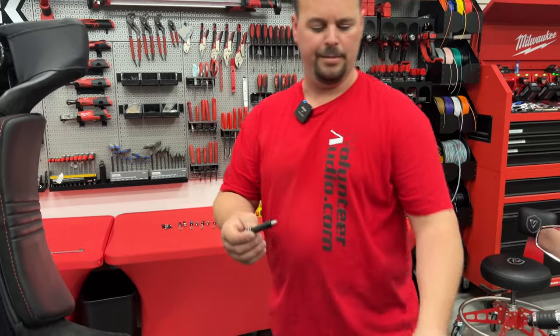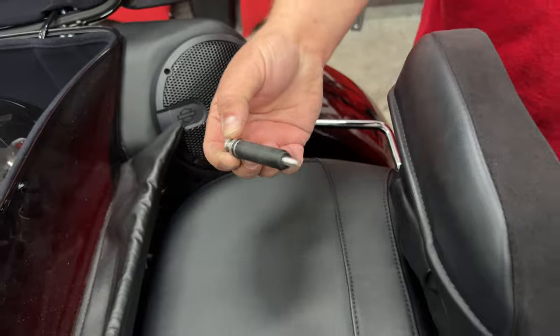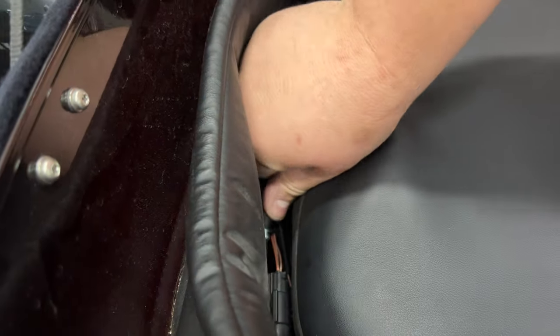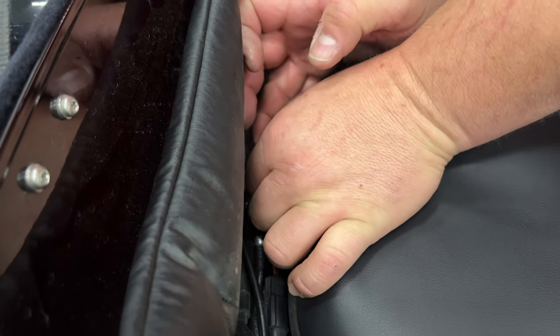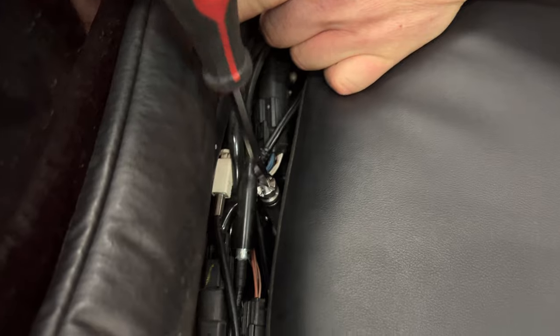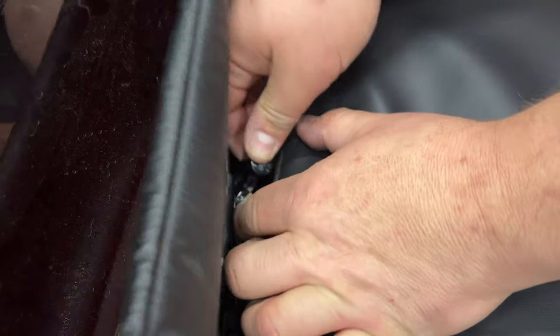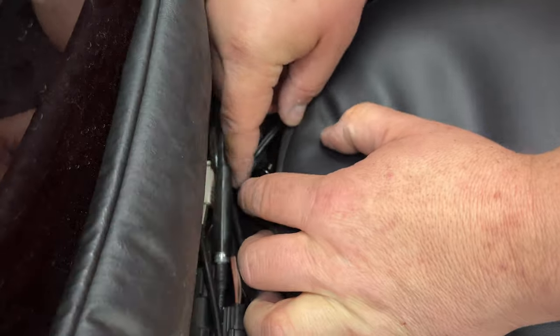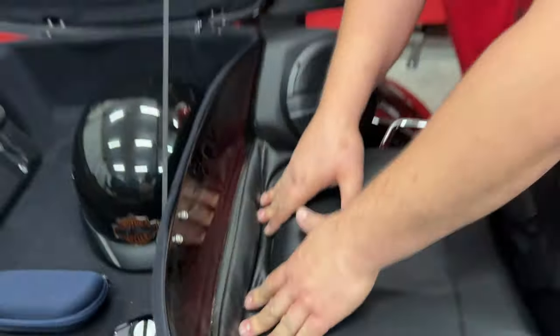Our solution from Robert Becker is a replacement. Look how nice this is — it's all aluminum, all machined, and it has this composite sleeve. The lock is going to be all aluminum. This is just going to go down into that factory hole. We're going to start it by hand, just as if it was a thumb screw. The top of this one, if you notice, we're not going to tighten this one with our lock — we're going to do it like the factory one. You'll notice we have that straight cut for our straight screwdriver, so now we're going to tighten it down with the screwdriver. If you want to lock it and tighten it with the lock, you can — it still has those half moons cut — but as you notice, there's not a lot of room, so we give you the ability to do this with a screwdriver. At this point, we simply put our lock on and push it down, close that lock, and now it can spin around to wherever we need to put our key in. Our seat is now secure. No one is going to steal it — they can't steal it.